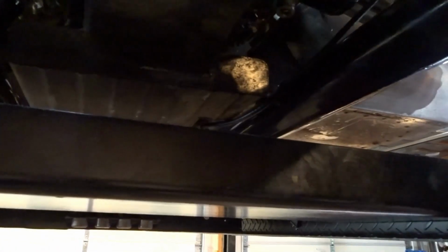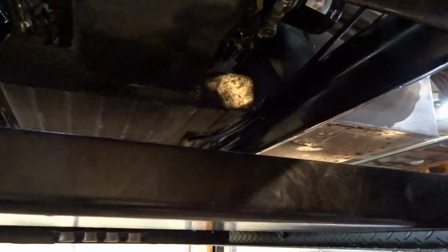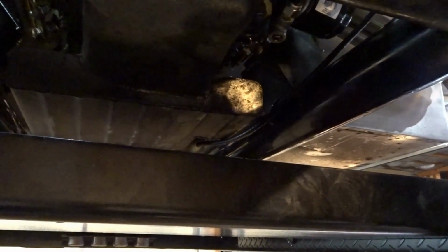As you remember, we've got that coolant crossover in the back of the heads, and I want to make sure that we don't have any leaks anywhere. So I want to check all that. I want to check all this with no pressure on it, just with the pressure of the actual coolant in the system before we fire it. And then we'll see if we've got any instance of leaks and take care of those and address them.